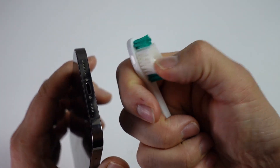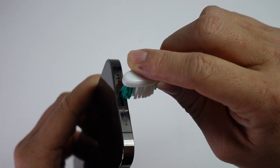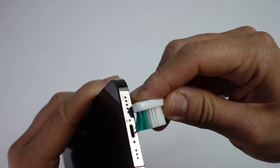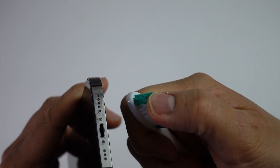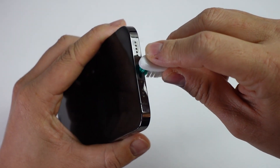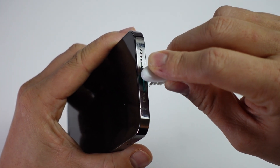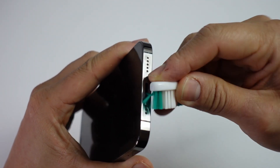With the toothbrush you can be quite vigorous with it, and if we go into the port like this, you can see that there's some fluff coming out of it. You'll be surprised to know how much comes out of a phone charger over the years — pocket lint like that. Basically you want to go through this process and make sure there's nothing stuck, because that's the primary culprit when it comes to loose phone cables.